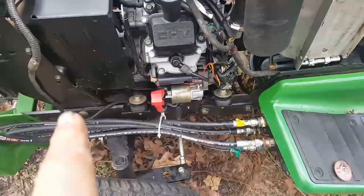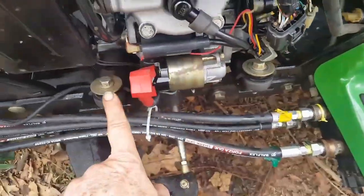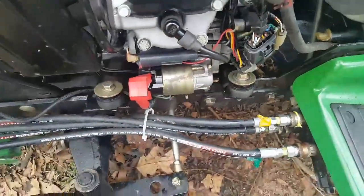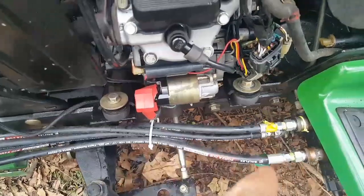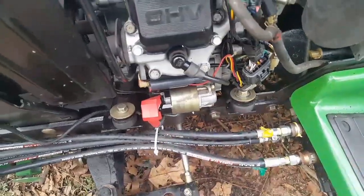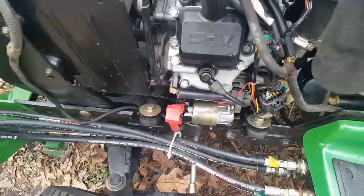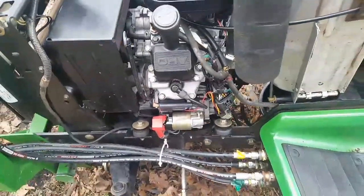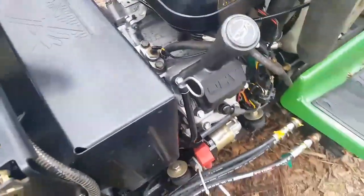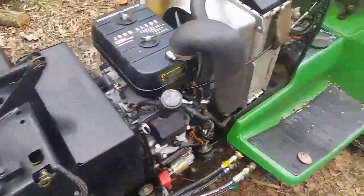So I took off the solenoid, identified the problem. The 2 bolts of the solenoid are real easy. That comes right off. And then I loosened off the 2 bolts for the starter motor. You would have to have the engine out to get it completely off. But I was able to ease the starter motor back enough to be able to hook the fork up, and then just bolt it all back in, and of course that was the problem solved. Although it cost me a couple of hours trying to work out what was going on. I had to do a lot of electrical testing and to find that it was not really an electrical problem. It ended up being a mechanical electrical problem. So that's solved, and she is turning over.